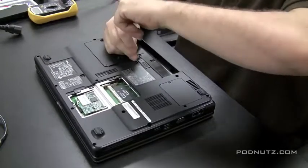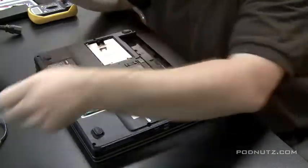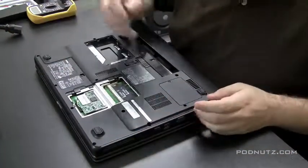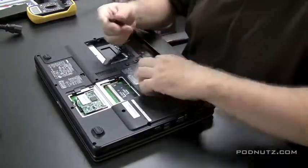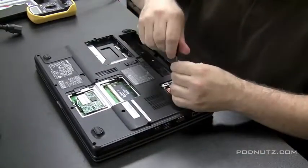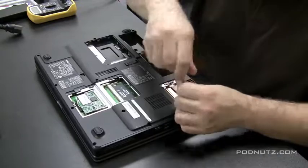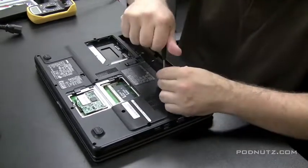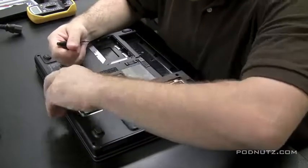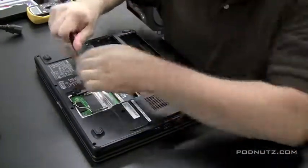The reason I do this is I want to get everything out of the way. Since I'm going to be working on the motherboard, anything attached to or touching the motherboard needs to come out first. I also lifted a flap that revealed the heatsink sitting on top of the processor, so I can take that off too. I'm pulling off the wireless card — I'll explain a little later why it's really important to get the wireless card out.